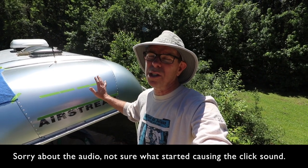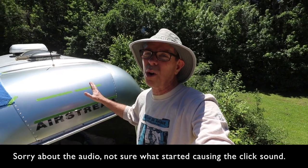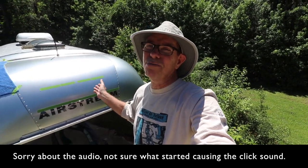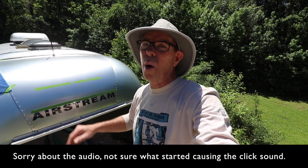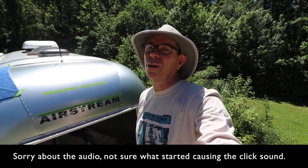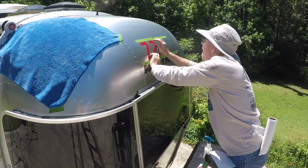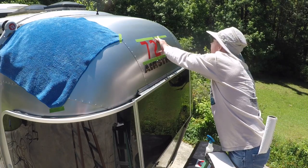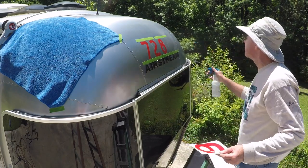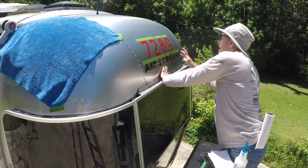Now that I've got my area marked with center lines, I've already washed the front of the trailer with soap and water this morning to get all the bugs off, but I'm just going to make sure there's no grease from my hands or any dirt. I'll take some Windex or multi-purpose cleaner and do a secondary clean on the front of the Airstream where the numbers are going to go, to make sure I get a good bond. At this point we are ready to start applying the numbers. We start by spraying the trailer surface with a solution of soap and water. We use this same solution to spray the adhesive side of the number as we remove it from the backer — this prevents the number from sticking to itself. The numbers are very sticky, and spraying with the solution makes it possible to apply them without fear of ruining one during this step. We are just trying to get them positioned correctly, not permanently stuck yet.